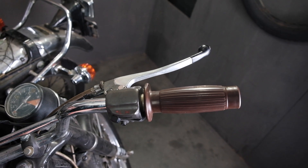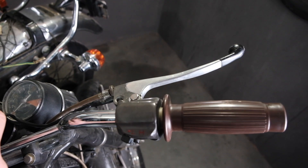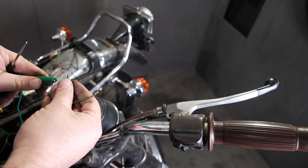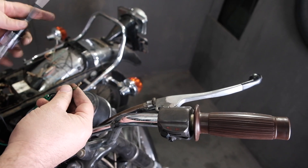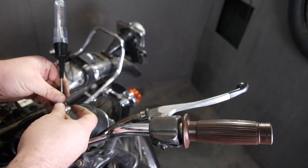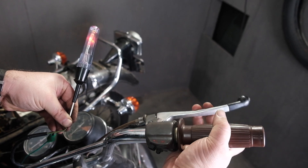For those with a front drum brake, here is the brake lever and the actual switch for the front drum brake — we have it unplugged right now. Again, solid black wire and a green and yellow wire. I'll connect the solid black wire to the 12-volt positive battery and the test light to ground, touching it right at the end. I'll give the lever a squeeze and make sure the light kicks on. Our switch is good.